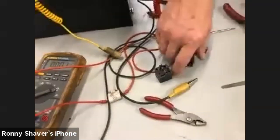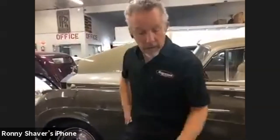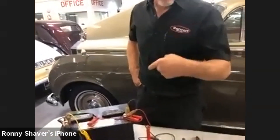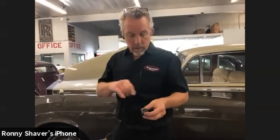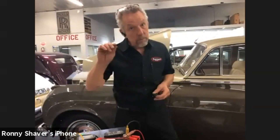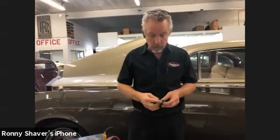You might wonder what do you need a relay for when you could just do it all on a switch. The idea behind the relay is to get a cleaner, higher current power source to your load. Your load is a motor or anything else that takes a lot of current — AC clutch, AC fan, window motor. Remember, current creates heat on smaller wires, bad connections, and resistance.